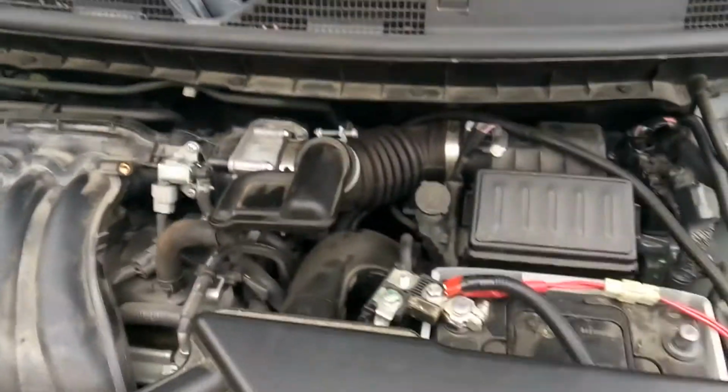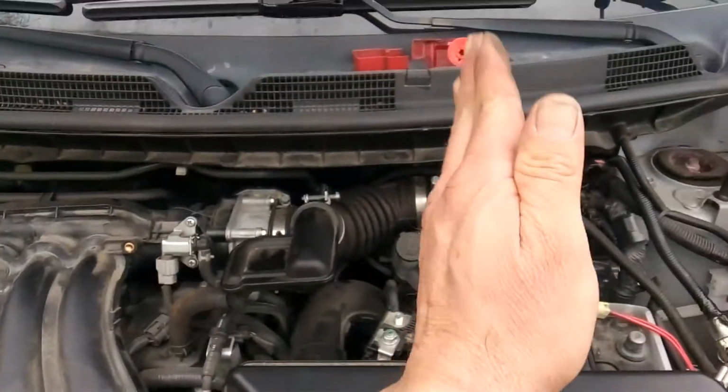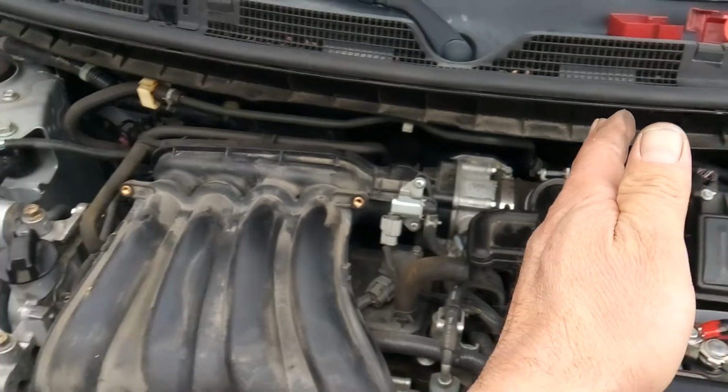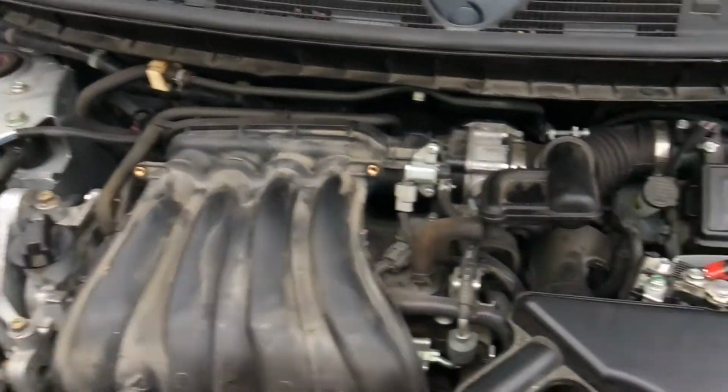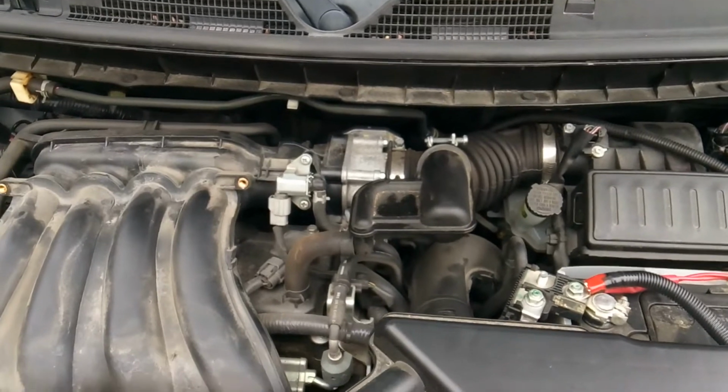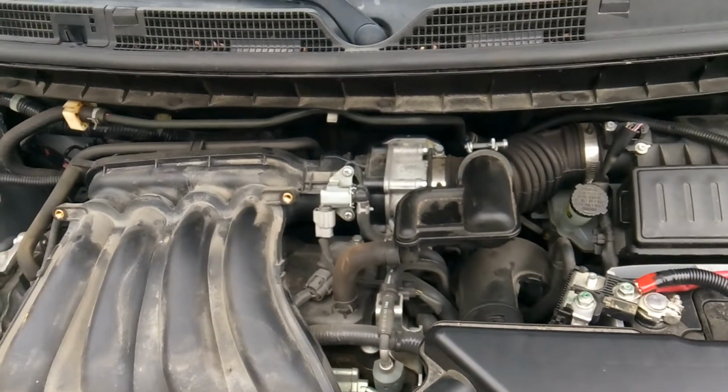I'm gonna go ahead and start, like I always do, on one side of the engine, which is gonna be the driver's side, and like a typewriter, work my way over to the other side, making sure I get all my electrical connections, nuts and bolts, all that other stuff disconnected.